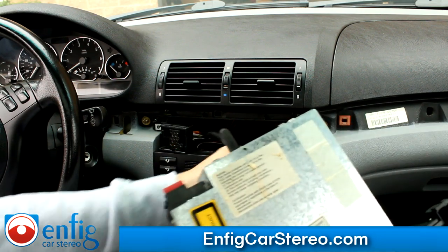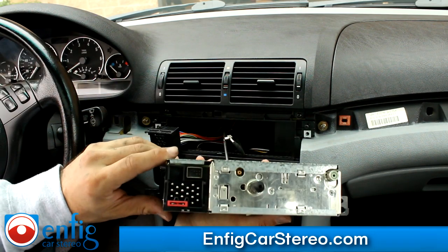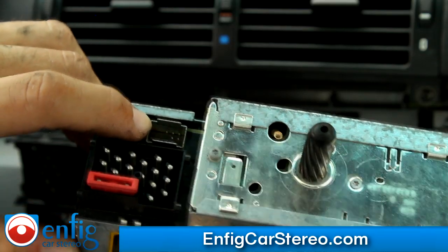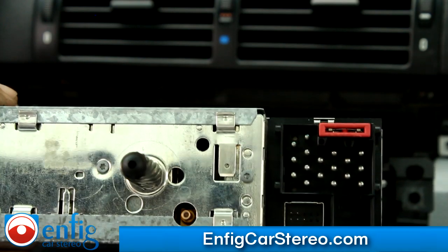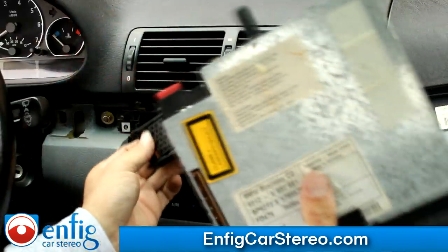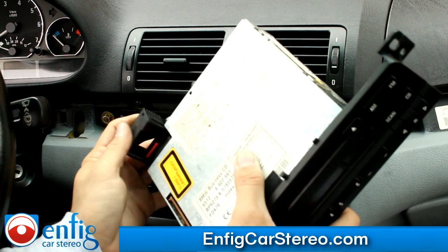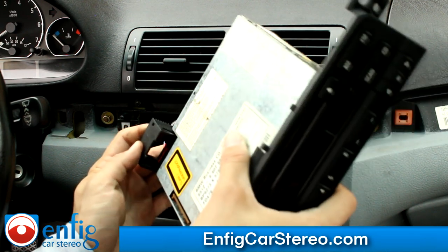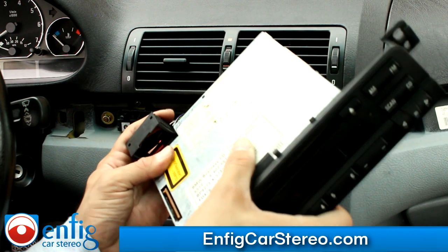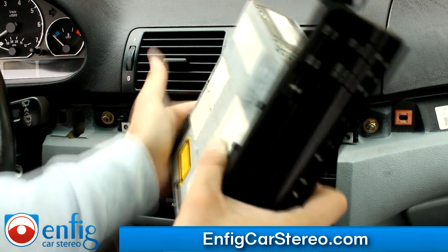I'm going to leave the antennas for last. If you look at this, you'll see there's pins there that are missing — you can tell where it goes because there's no pins towards the outside of the radio. So that's where your audio cables are going to be. We're going to plug these in — lift that up. It's a little tight for video but it's fine because we have that up there with no chance of it interfering.